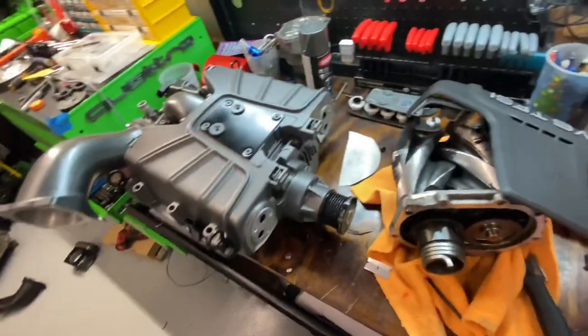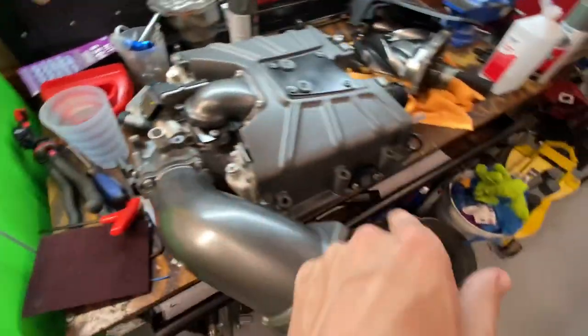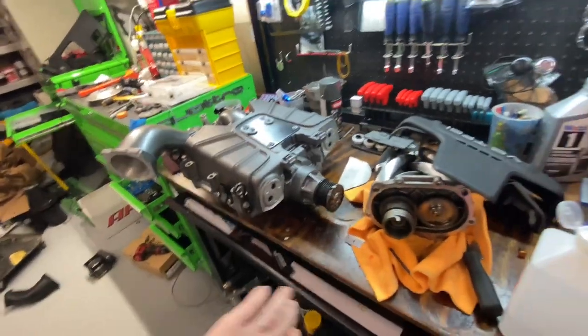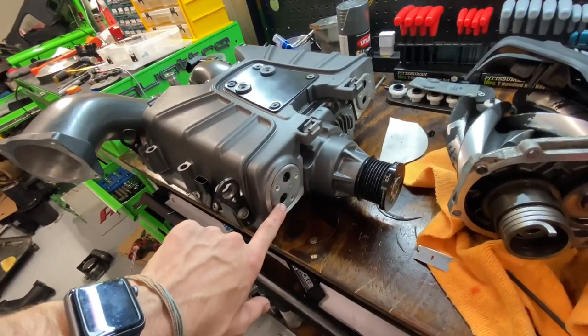Since last update, a good bit has happened. I did get the new PCV in and got the intake runners back on with the new green gaskets and the new orange ones underneath. I've got this new PCV hose connection. Got everything cleaned up pretty well. Also in the meantime, I have fully assembled the new supercharger. The snout is on, the plate's on, bypass valve in, all the map sensors in, got the APR noodle — this is the custom noodle bolted on, coolers pushed in. Velocity AP has a new product — pretty much deleting the connection tube, so it's two billet pieces and you make your own crossover tube or send it to a divorce or double pump system. Me and Cameron from Audi C7 Owners have been brainstorming — we've got something cool coming.